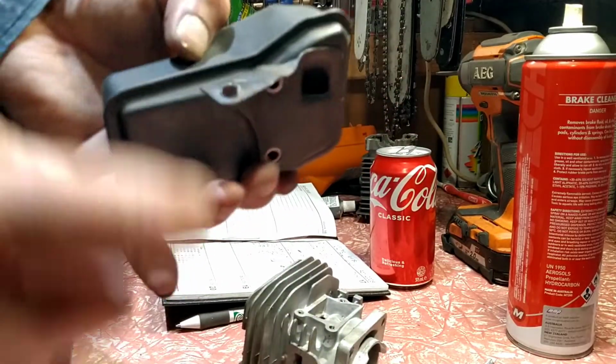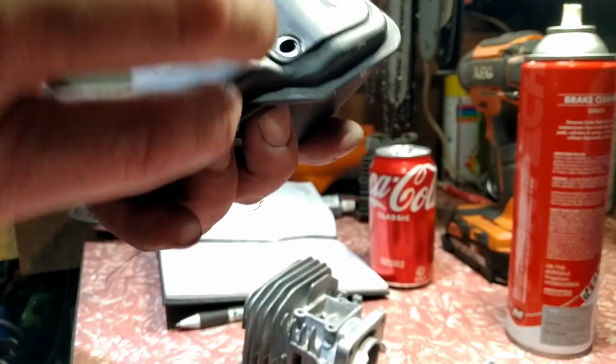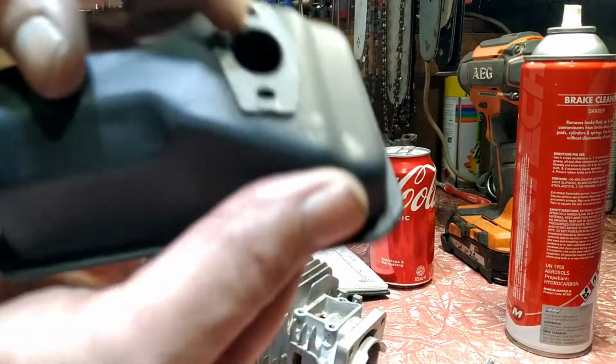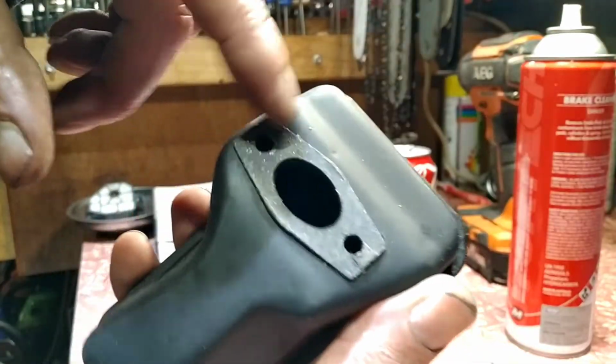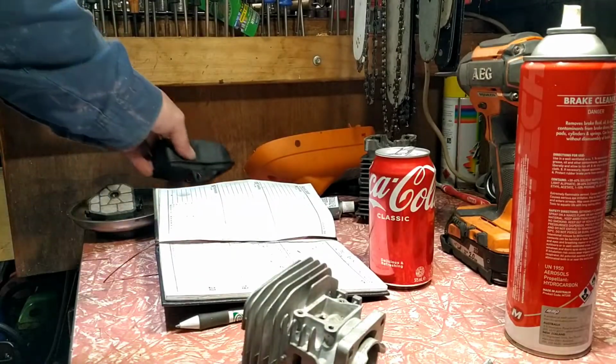The timing was no good, but this thing, it can't breathe. That's what it is. So I'll have to go to a mate's to get an oxyacetylene, but I'll cut a hole through here, leave that baffle there so it hits that, but it can escape straight to the side. But that's my plan for that. Anyway, that's it. I'll keep on working.